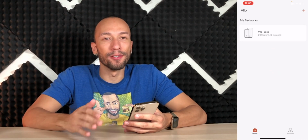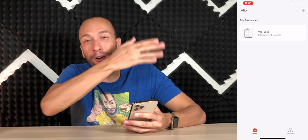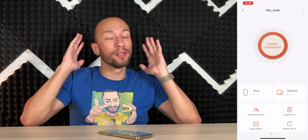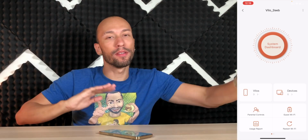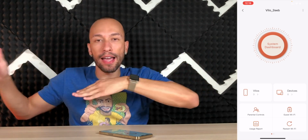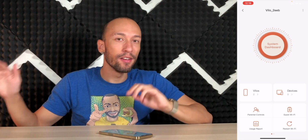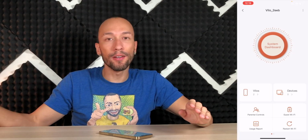Really, the whole network is useless coming over here, and I'm not that far. I mean, there's walls, but really, it's not that far. If this would connect to the other beacon, I'd be golden. Alright, so with some trial and error, I've come to the conclusion that this setup is basically useless for me because you can't daisy chain them all together in a line, connecting beacon to beacon to beacon to beacon to create a long chain of connection. You have to connect each beacon to the main router, otherwise it's basically useless.